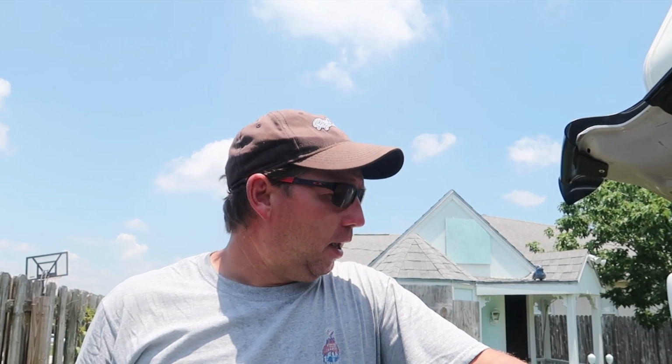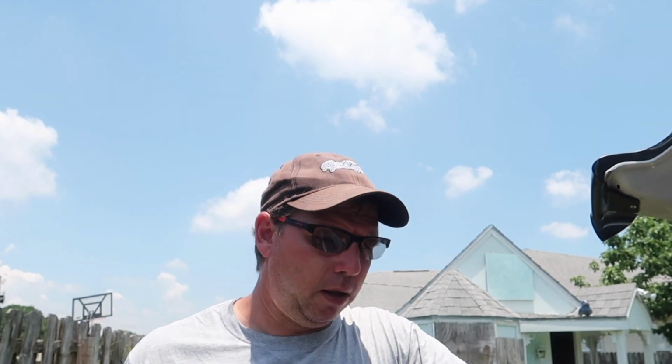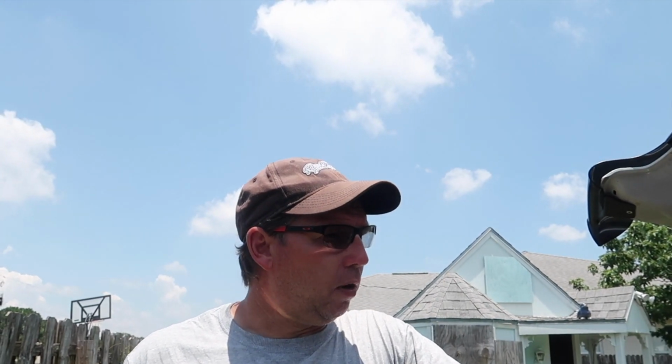All right, we are down in South Florida. It's about 110 degrees, at least it feels that way. And if you guys have the E450 chassis, which a lot of RVs do have, you might run into a problem like I just discovered this morning in our coach: when we turned the air conditioning on, we were only getting air through the defrost. The selector wasn't working.